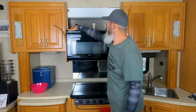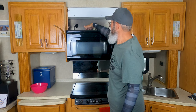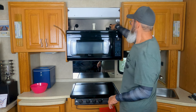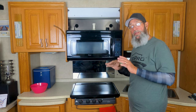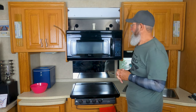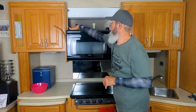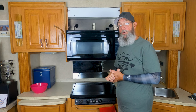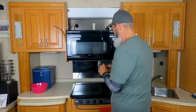The microwave in the front has two Phillips head screws that hold it to the mounting plate. The first thing we're going to do is take a flashlight and peek back in through these holes to see what the arrangement is on the back part of the microwave — we don't know how that's secured yet. Eventually we'll be taking these Phillips head screws out, letting the front down, and then dealing with the back. Let's take a look in there and see what we're up against.